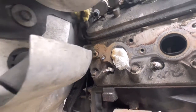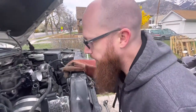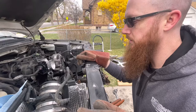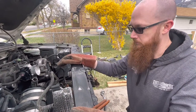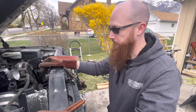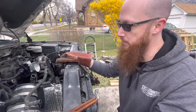Okay. So it'll harden, stiffen up, and you'll hopefully be able to grab onto it with the vice grips and give it enough. If not, then we'll weld at it again. Would slapping some PB Blaster over it maybe be beneficial? No, it won't make any difference. The heat will do the same thing the PB Blaster did. Oh, good point. Expands, cools, loosens it. Yeah. So it's got a whole bunch of heat on it right now.